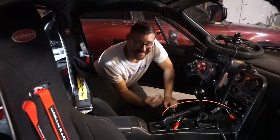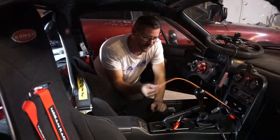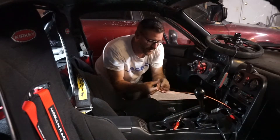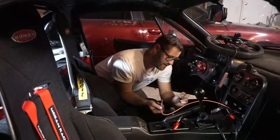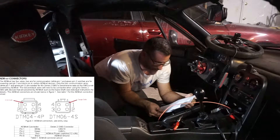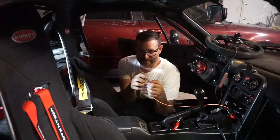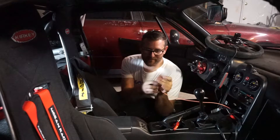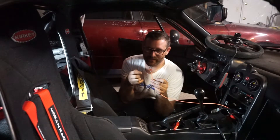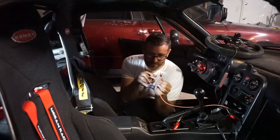We're about to finish the car up. James came over and saved me with a crimp tool, so now we can actually crimp the DTM connector pins properly. The last thing we have to do is hook up the DTM connectors from the AQ-1 to our harness and then our harness to our wideband. I'm going to read off the pinout here provided by AEM to make sure I'm doing it right. DTM connectors as a whole — very, very simple. Now we've crimped our pins or sockets onto each individual wire strand, ensuring the pinout is correct.